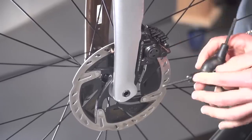This is a problem I've had on a couple of different bikes in the past. What it is, as I'm riding out of the saddle or applying more force through it, a combination of a little bit of flex in the fork is meaning that the caliper can move enough to just rub on the rotor. It can be flex in the wheel as well — most likely some flex occurring somewhere in the system. I've got two solutions for you. One, go down a rotor size — that'll help reduce the amount of flex because you're bringing everything closer to the central point. Two, work out which side it's rubbing on and then offset the caliper ever so slightly — that was how I solved the problem.